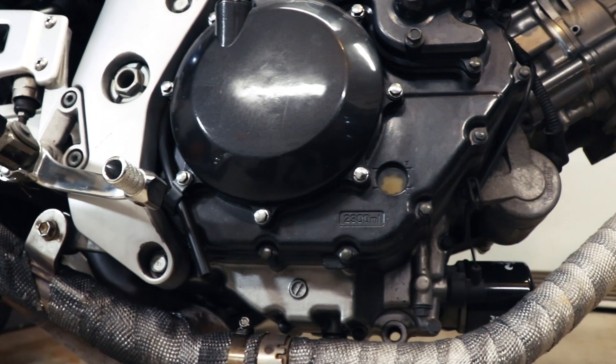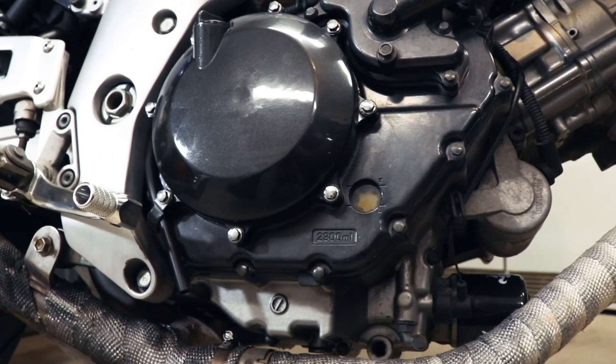Following up on this — I'm happy to claim that finally we have defeated the oil leak at the clutch cover. It's actually a couple of weeks later and I've taken the bike out for several rides including just now. After several heat cycles — heating the bike up, riding it, letting it cool down — there's no leakage at that mating surface. Failing just the gasket, you can use some oil-rated RTV to seal it and get the plastic cover to seal. The RTV costs just a couple of bucks and seems like it'll fix your problem — at least it did in my case. Hope this helped!